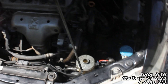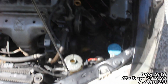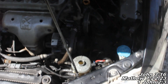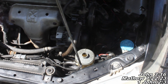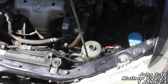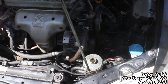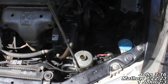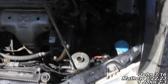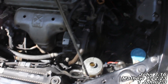That pretty much concludes today's video of what can happen when you use the wrong kind of power steering fluid. Also, if you do use the regular power steering fluid — not mixing them, but just using that regular power steering fluid — it will greatly, greatly reduce the life of your power steering pump. What I mean by greatly is it will destroy your power steering pump in just a matter of probably 5 to 20,000 miles. So it's really important to use the Honda-specific power steering fluid. It will cause damage to the system — there's a reason they do it, they don't just do it for kicks and giggles.